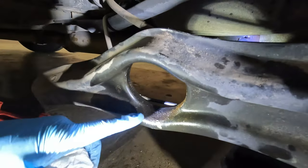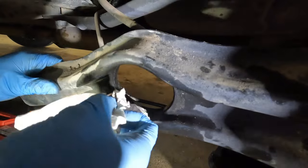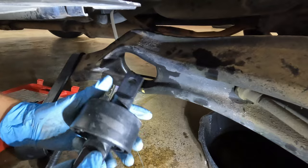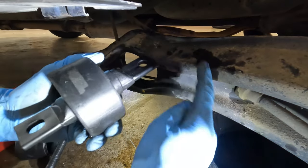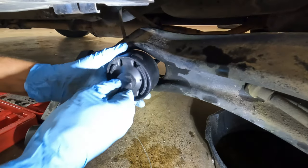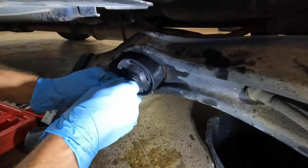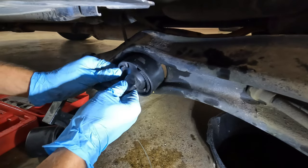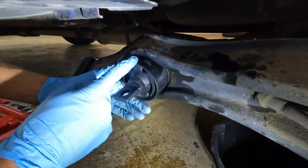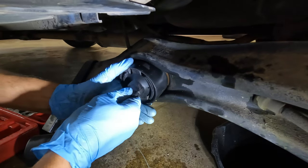Next I'm just going to clean all the dirt in the mating area and around it. A few things to note before putting the new trailing arm bushing back in: one, we're going to have the long part inside the car and the short part outside the car. Second, whenever we put the trailing arm bushing back in, you're going to figure out if you want to cant it clockwise, counterclockwise, or try to get it as straight as possible. If you're on stock ride height, put it back as straight as possible, perpendicular to the trailing arm — that's how it is from factory.